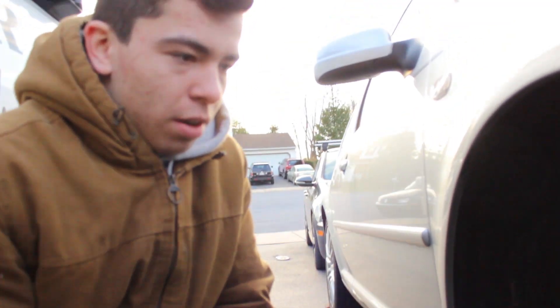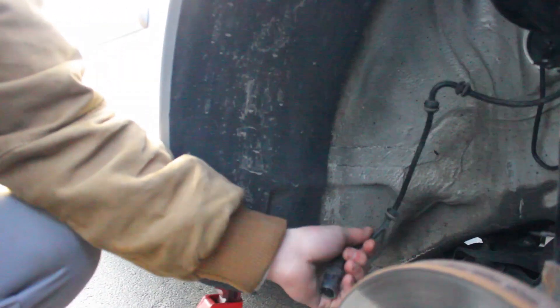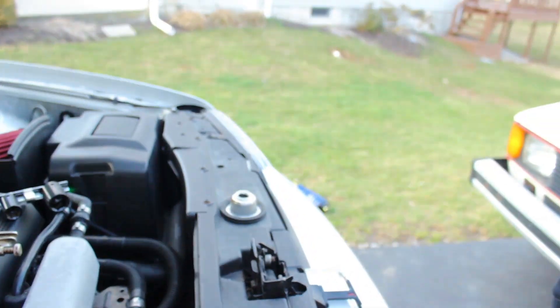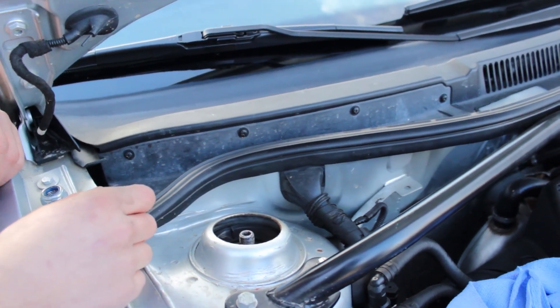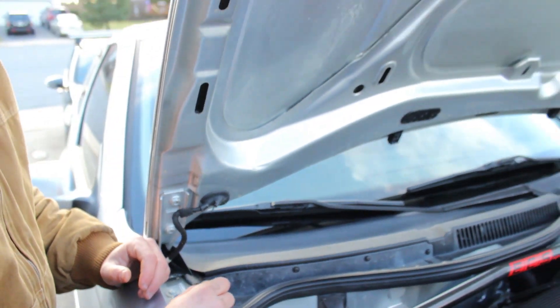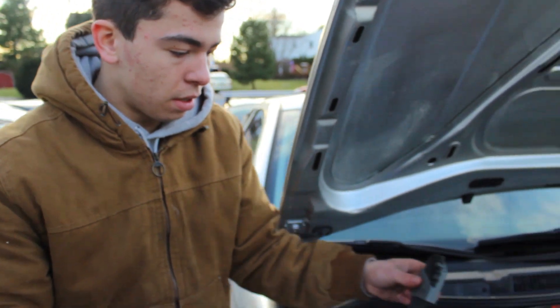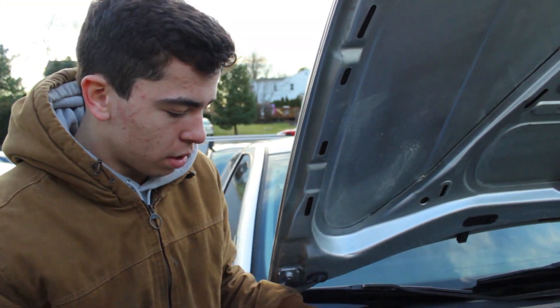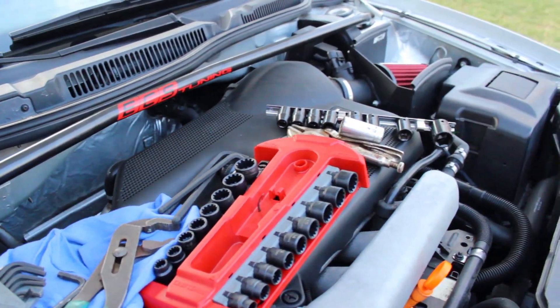For the front — I pulled off the connectors; there's also a little connector here, just pop that off. That makes things easier. You get this little cone thing that sits in here, and there's a nut that goes on top of that. It's a very difficult thing, so I'd recommend getting the tool for it. You can use a spark plug socket — we have a custom made socket. Pop an Allen key in the center and then you need a socket on the outside to pull this off. It's 22 millimeter. ECS sells them — it's a special tool for struts, just look it up.